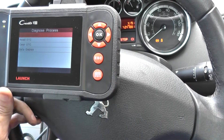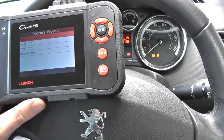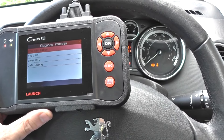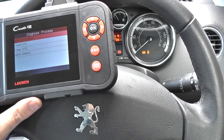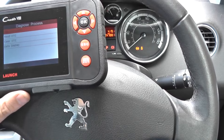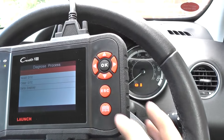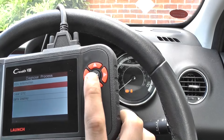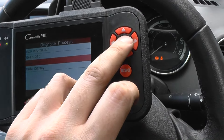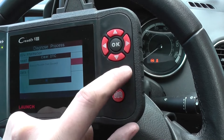We're back in the vehicle after changing the ABS sensor. The time it takes depends on your experience — it took us about half an hour, but please allow around one hour for the job. It also depends on whether the ABS sensor is seized, which can take longer. We're back in the vehicle now, so we'll read the codes first — we expect them to still be there since we haven't cleared them. We'll go to 'Clear Diagnostic Trouble Code' and confirm yes to clear it.